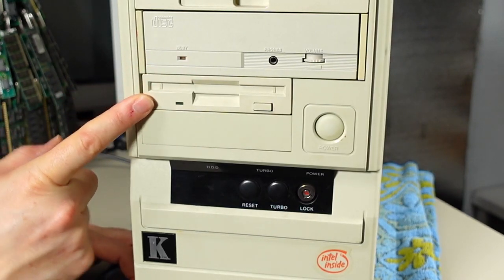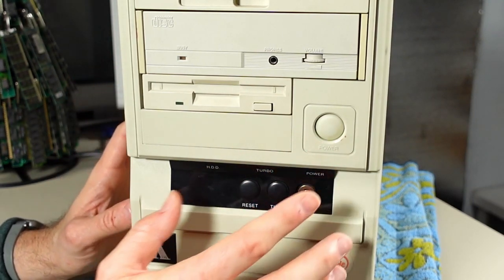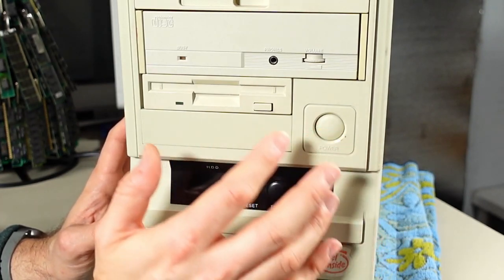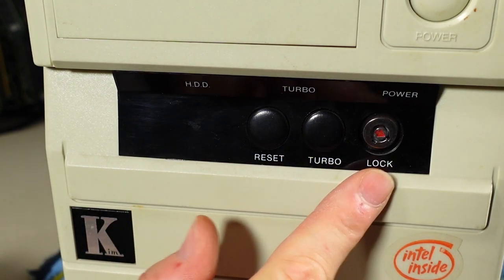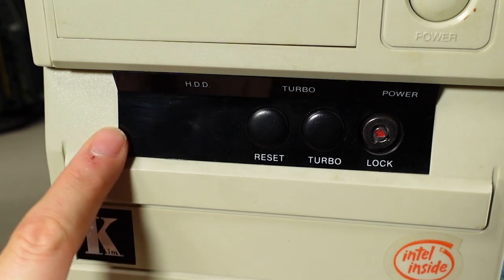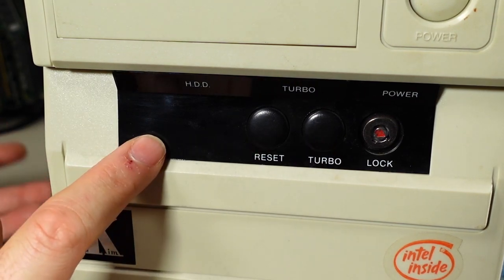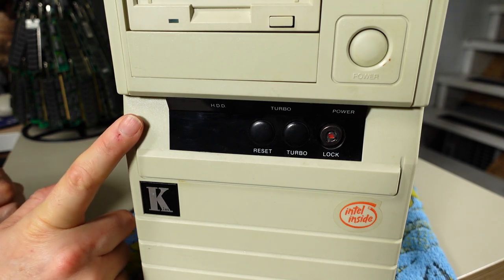Under the CD-ROM drive we have a standard 3.5-inch floppy drive. There is the power switch — this is a hard power switch because this is an AT motherboard, there's no soft power on or off. The 120 or 240 volts mains actually comes right to the back of this switch and you interrupt or give power to the power supply itself. It has a flying lead that comes out of it and this switches both the live and the neutral to the power supply. Next up we have a small panel with a key lock, a turbo switch, a reset button, and a series of LEDs along the top — power, turbo, and hard drive. Most likely behind the blank area was a two-digit numeric display showing 66 MHz for a 486 or 33 when you push turbo. It was very fiddly to adjust and optional, so not all cases came with that numeric display.